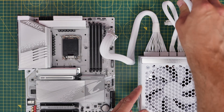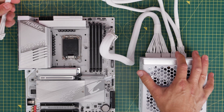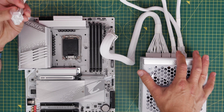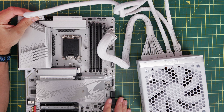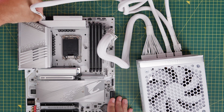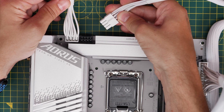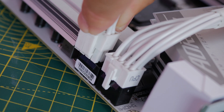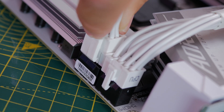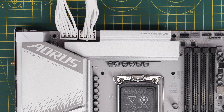If you've got a high-end CPU or a decent motherboard, you'll find these plug in again with the same sort of logic. All of these power cables have little clips on them so you can only put them in one way around. You'll also find they have different style connectors — flat and round — at the top. Have a close look and you'll see what I mean. The plastic clips go over the little notch on the sockets so they seat in place perfectly and are held down there.